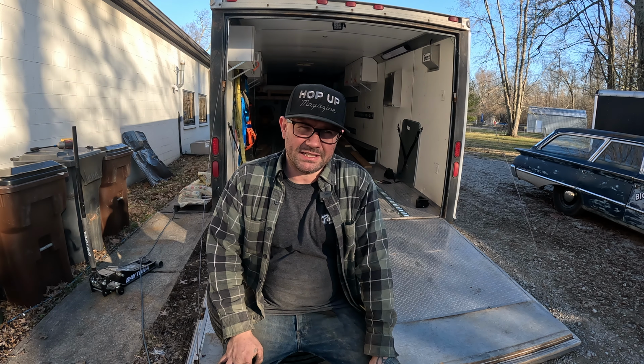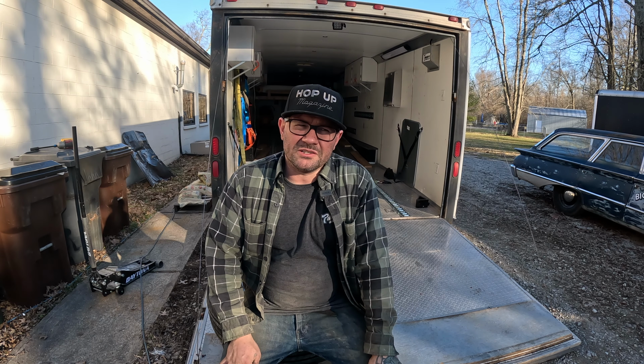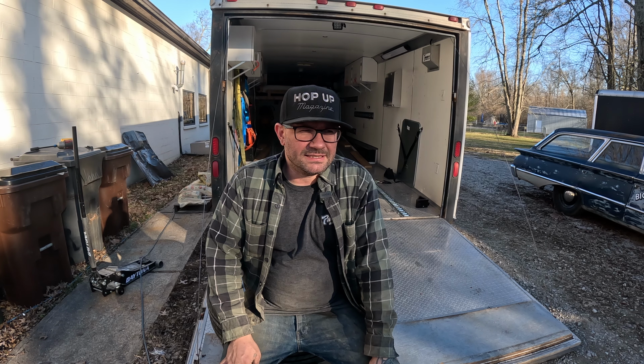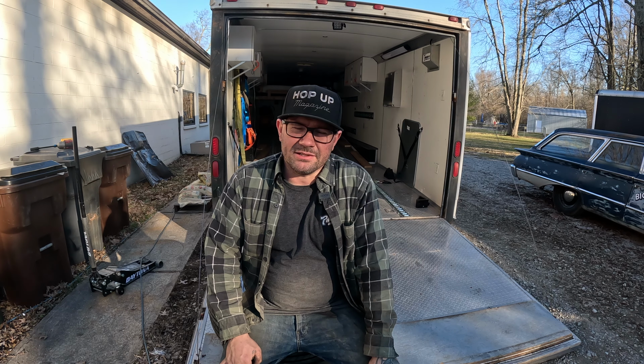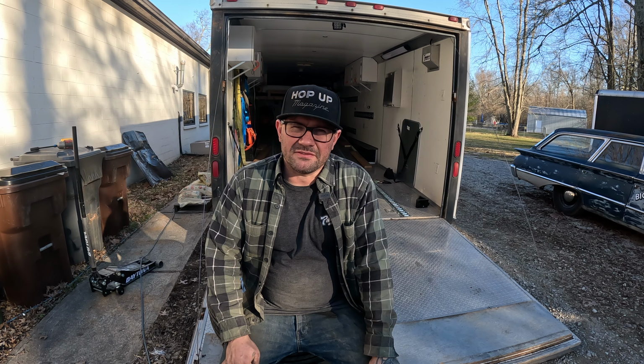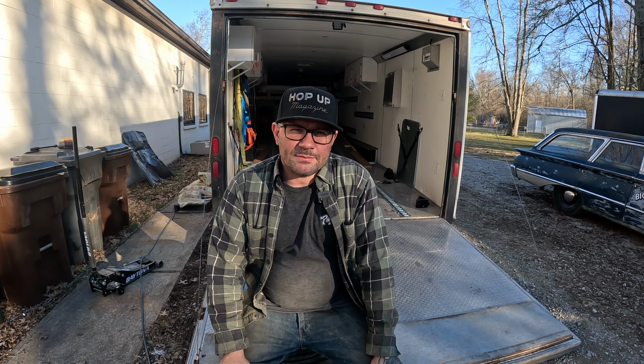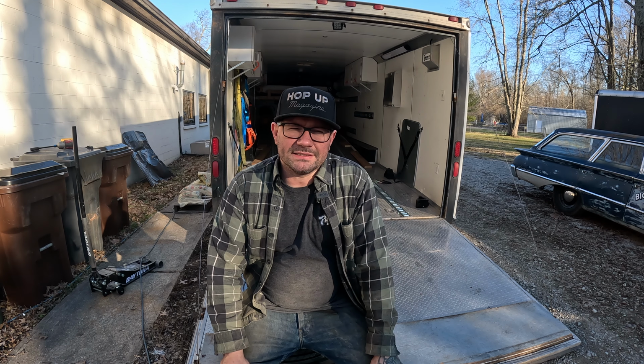Especially being a trailer this big, 48 feet and able to haul 2 cars, I really feel that a 14 ply tire is better than either the 8 or 10 that was on there. It was kind of confusing because it didn't specify the ply rating as easily as these tires do. So I got them all switched and I'm feeling a lot better about that.